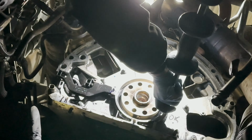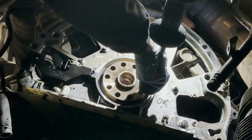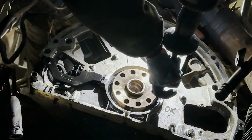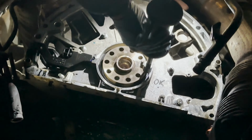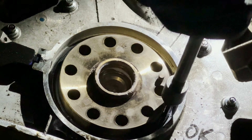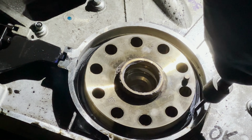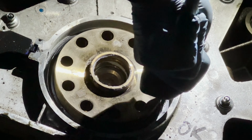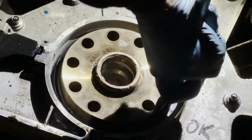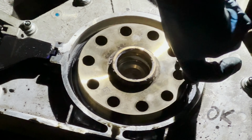We are using a small slide hammer and a screw in the end of that slide hammer. And what you're trying to accomplish is screwing that screw into the seal between the crank and the rear cover. See that hole? He's gonna try to get another bite right here on the other side. You can go right in the middle and not scratch the crank or the rear cover. I may have said front cover before. I meant rear cover.